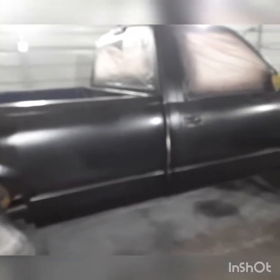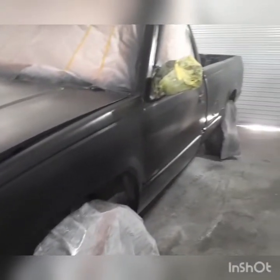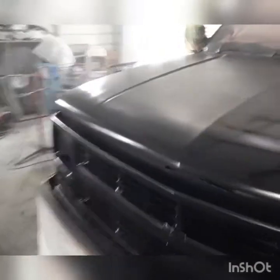But everything on the back looks pretty good. I don't see nothing back here. But like I said, this will show you the imperfections, and I got about four or five spots I got to fix before I paint it. But she will be ready to paint real soon. I'm gonna let this get dry, let it set out here for a couple of hours. It's real nice today, so it's 70-some degrees inside this shop, so it should dry pretty fast. And when I come back, I fix them spots, then I hit it again in them spots with the black and see what it do. And then if everything works out, I should be ready to spray it pretty soon, depending on the weather.